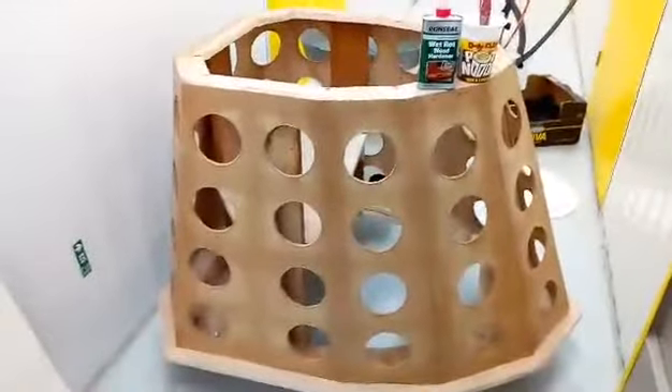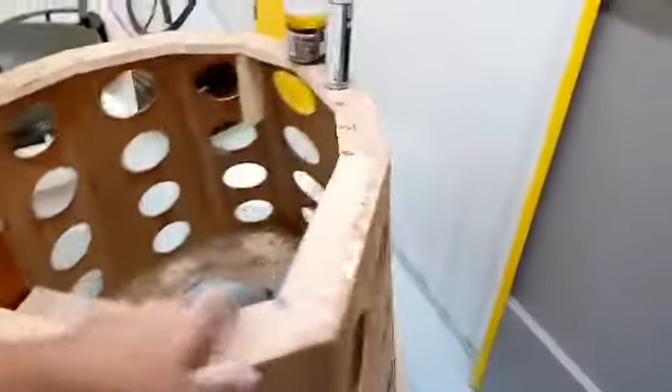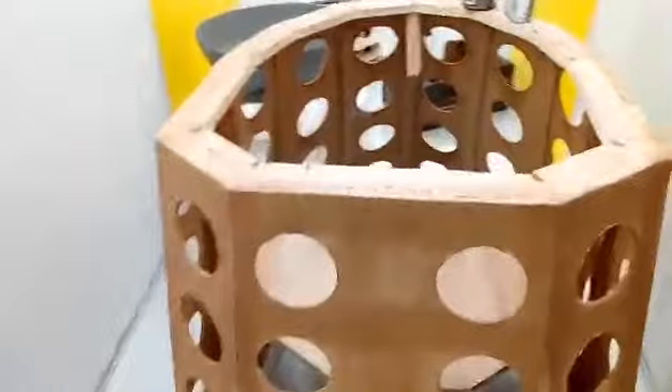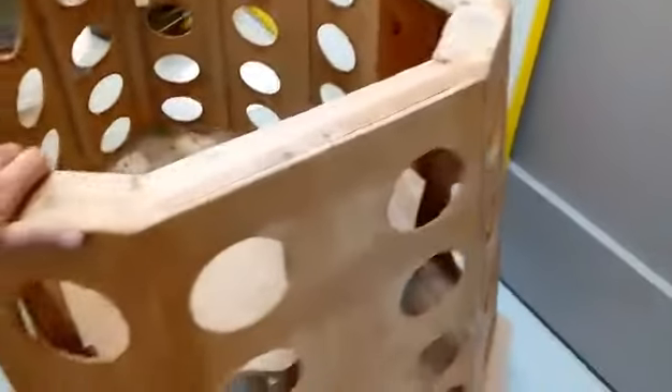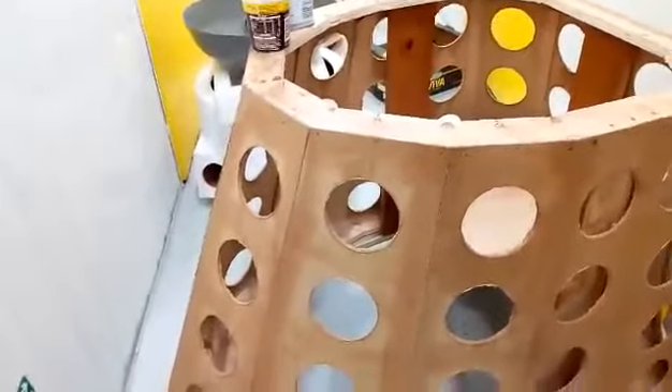Like I said, I'll probably have to get some more just to make it less patchy. Once it's got an even surface of that stuff, in theory the paint will go on nice and even as well, because it'll have a non-porous surface. That's basically what you want — a nice surface that acts the same way as fibreglass, where it's non-porous, you can spray straight on it and you don't have to put on too many layers of paint.